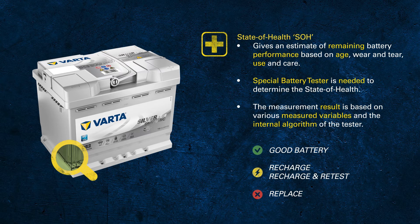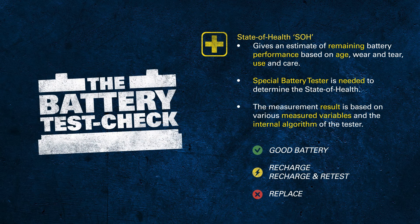This could already be an indication that the battery will come to the end of its life, and you might inform the customer about the risk of a potential breakdown and recommend a preventive battery change at the next winter season. The state of health becomes even more important for vehicles with start-stop functions and/or sophisticated electrical functions, since the battery has a more integrated role within the vehicle's electrical system.